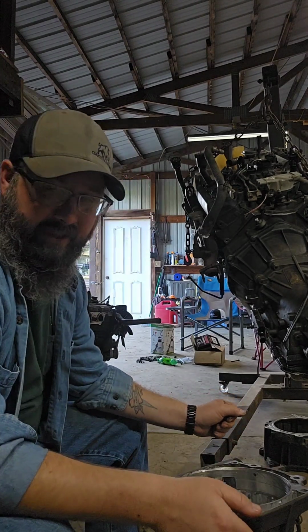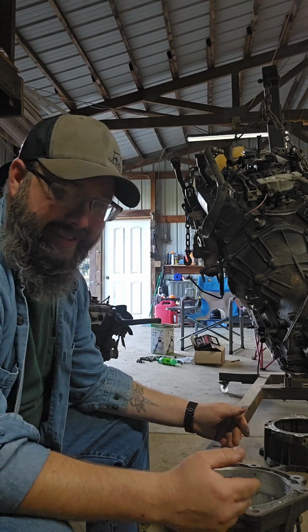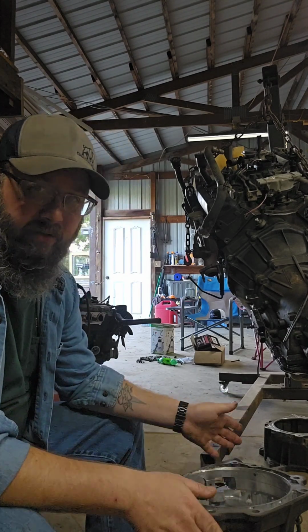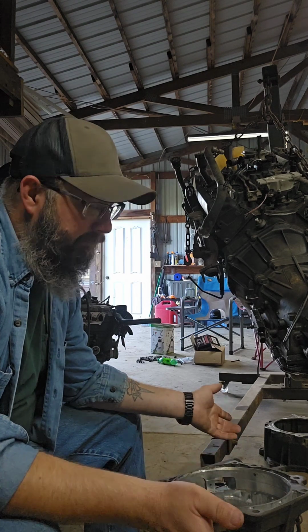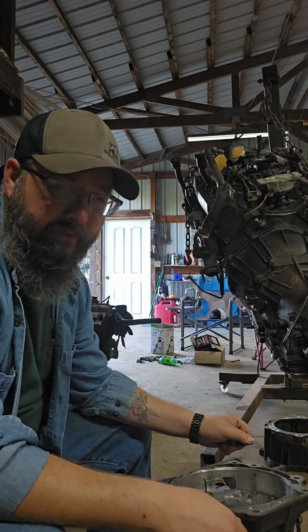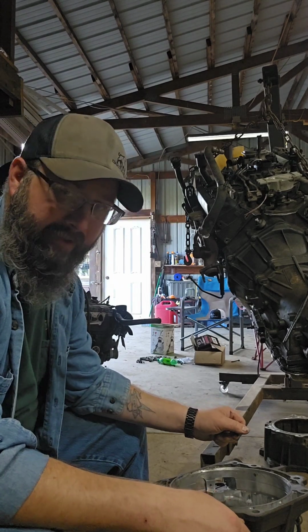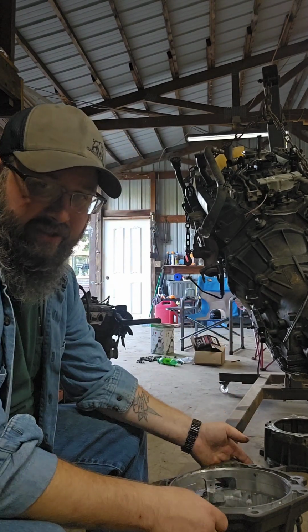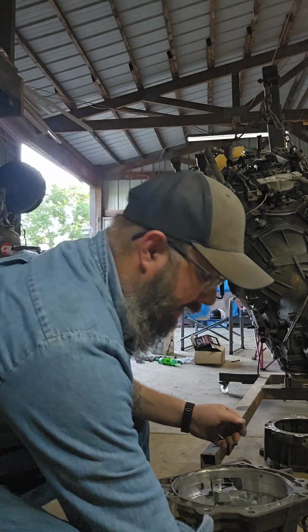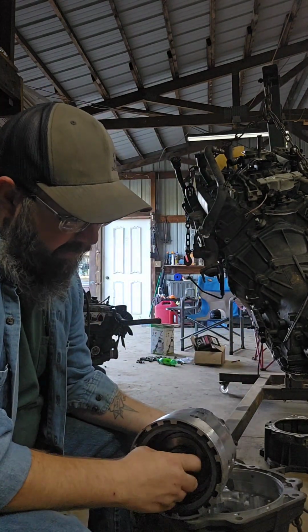The Jimmy was 4-wheel drive. Didn't think about it. In that case, the tail shaft, the tail casing was all different. So instead of wasting time running around looking for a transmission, we decided to just swap everything out. We pulled the front pump out of the transmission, as you can see here. Ended up pulling the front pump shaft, clutches, everything else out.